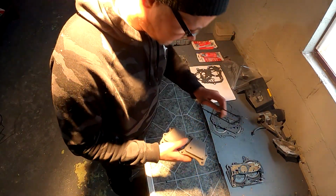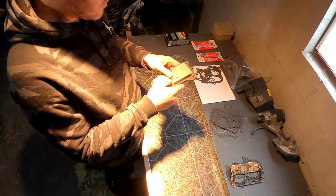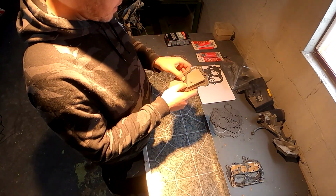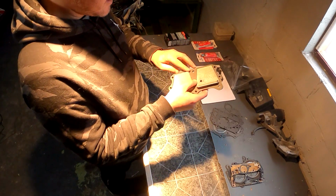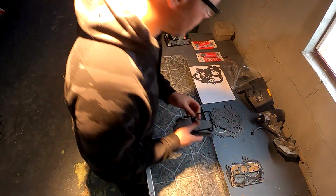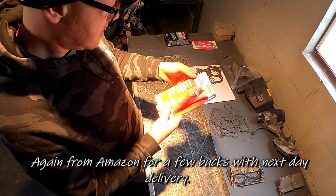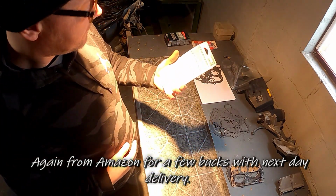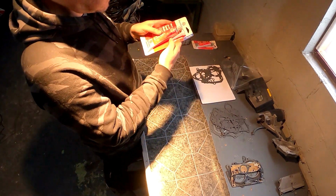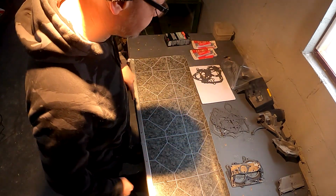This one here, I still need to finish cleaning in here, which I'm gonna do. And I read that I should put a very thin layer of gasket sealant on these two when I'm reinstalling them. So I did buy the red high temp gasket sealant here. Hopefully it's the right one. Put just a little dab. It has the plastic tip here that I only cut a little on an angle off the top. Should make it a little easier to put it on.